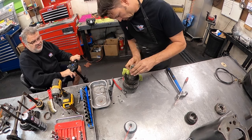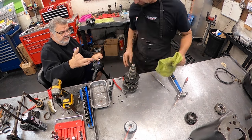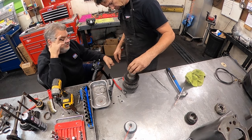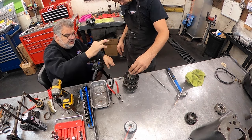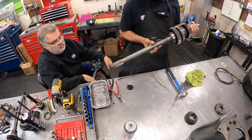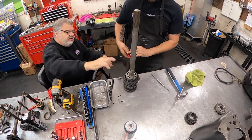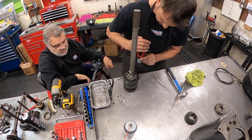That's the machined part of the shaft. We didn't have to take that apart, but it needed that new snap ring. We can turn it around - we've got to pull the other side apart now. We've got to pay attention to the grooves in the bearing - the groove goes to the back of the unit. Got to keep an eye on that.